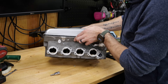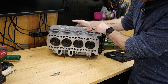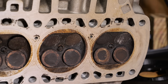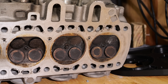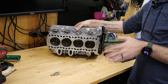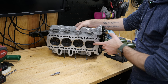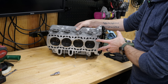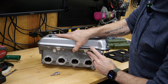Before we take the top off here, I want to show you guys the bottom — this is the piece that is so special. You can see here each chamber has four valves: that's two intake, two exhaust, and they are staggered, which means they are interference-style valves. So there is some consideration when you get into the pistons. These chambers, surprisingly, line up almost perfectly to an A-series block. The stud pattern, though, is slightly different.